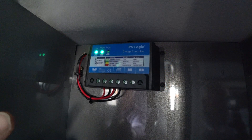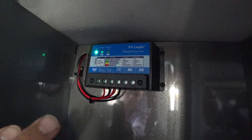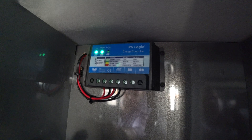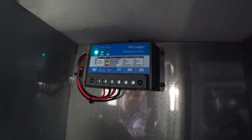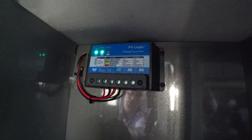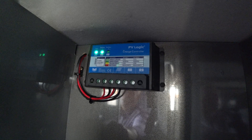It's worth noting that in the cabinet there's a solar charge controller which only appears to be wired into one battery — but that's as it's meant to be. It does connect to two batteries, but it does so downstream of this solar controller. As long as that light is flashing you have charge going in, and then the Sargent system prioritizes which battery it goes to. It's not the solar controller that prioritizes — that happens downstream of this unit — so don't worry about only seeing a connection to one battery; it does indeed charge both, but it does it in a clever way.